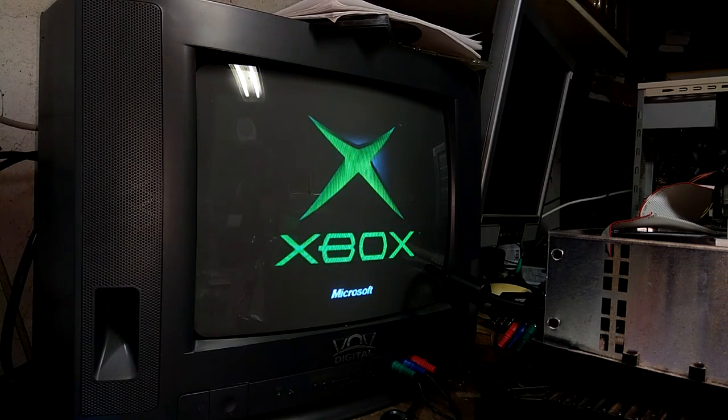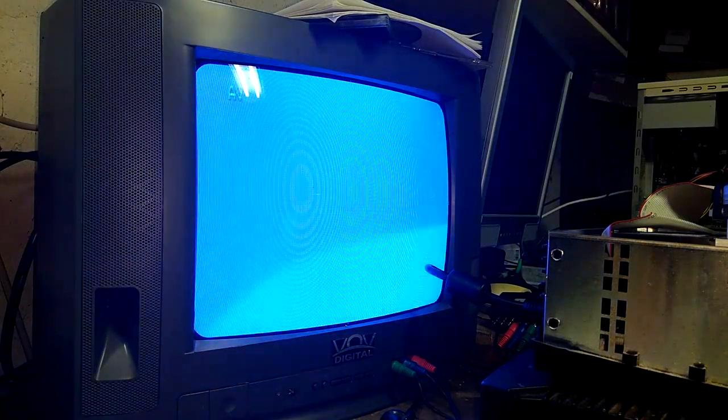Remember, since you have replaced the original flash with the Evox BIOS, you can essentially do whatever. You can just plug in a new hard drive. You don't have to worry about any of the locked hard drive business. You can just use an unlocked hard drive with the TSOP flashed system. You just have to drop in the new hard drive, drop in the Hexen disk, wait a little bit until it loads, and then you should be good to go. It will recognize it as a new hard drive, and then start setting it up for you. But yeah, Hexen does take a while to load up, as I've said before, so here we go.